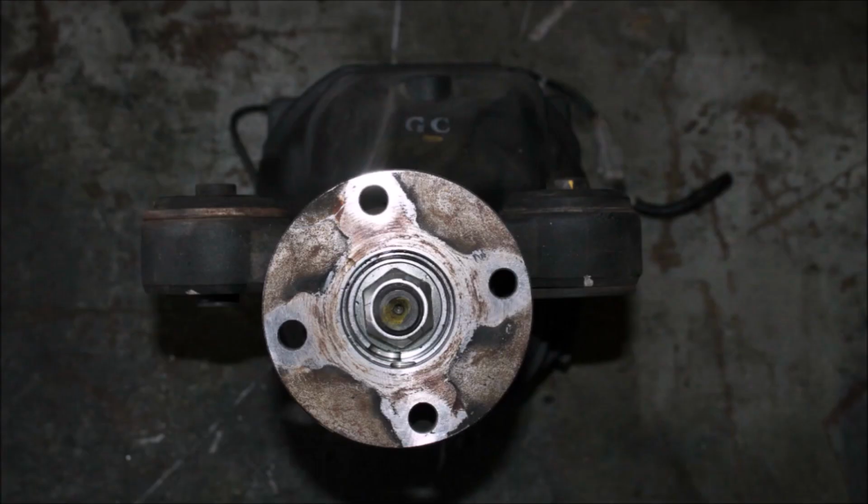One of the things I get asked about the most often is the pinion flanges. Nissan used two different pinion flanges. They used one, which I have pictured here, which is a circle, and one that is triangular. It's got 3 points on it with 3 different bolts. The circle uses 4 different bolts. The circular 4-bolt flange is used on all manual transmission 350Zs, G37s, 370Zs, G35s.